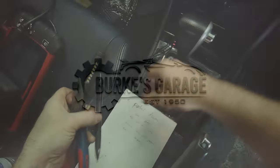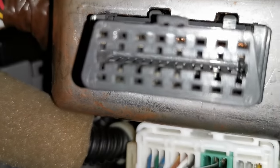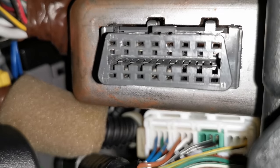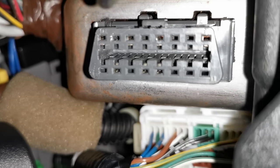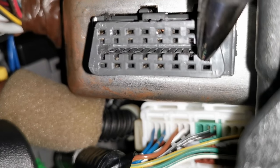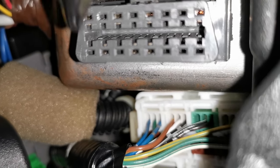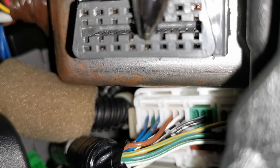To give you some context before we go into the reset procedure: I have a Snap-on scan tool and a Carmen scan tool as well, and neither of those were useful in resetting the VSA or that exclamation warning light on the dash. The warning lights came on because of a full system scan using a Snap-on tool — it wasn't brought on by any fault in the system. The light wasn't on before that scan was done and it just triggered it, then it would not remove afterwards.